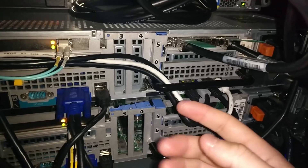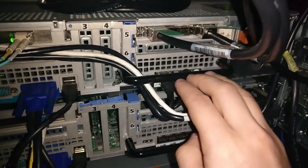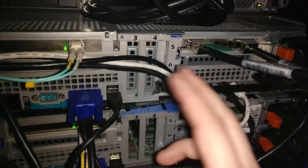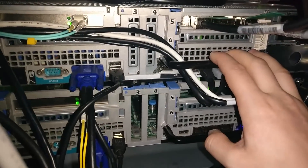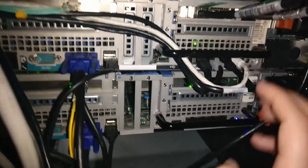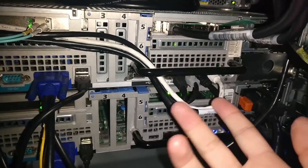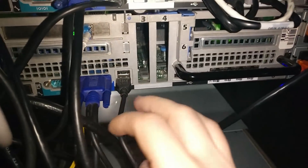It was a laughable idea. It has to do with the fact that these are gigabit and these are 10 gigabit — they're not compatible in link aggregation. It's like 10/100 versus gigabit. It's a totally different type of signaling. That just doesn't work.